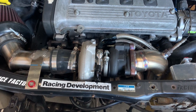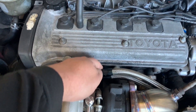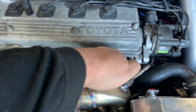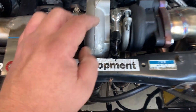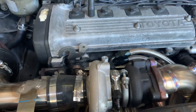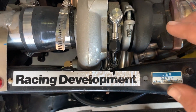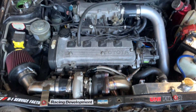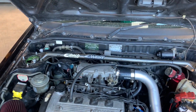You can see the turbo in its final place, just perfect. I've got the water feed lines running around to the factory fittings, and the oil feed - this was one of the most difficult parts. We spent ages trying to find a banjo fitting that would fit, and we've gone with this. As you can see there's not much clearance, but the positive is it's very close. The engine will twist this way on acceleration so it's okay.